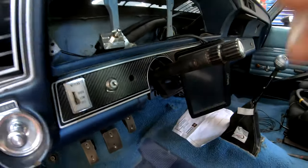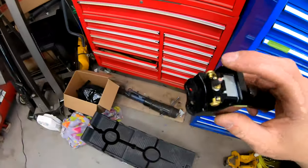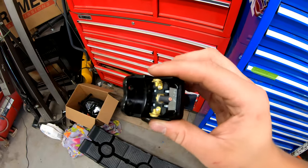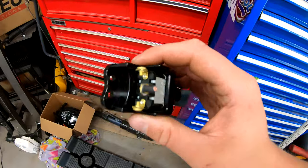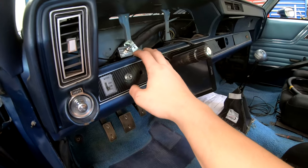I had to change my plan for the turn signal switch. This is an American AutoWire universal turn signal switch that I had to drill the dash to mount. Sadly, I won't be able to use the Motion Race Works billet piece — really my own fault for not having a great understanding of the turn signal system. The issue is it's a three-post turn signal switch, designed for cars with entirely separate turn signal circuits from their brake lights — power in from the flasher, then outputs left and right to the front and rear lights. Since this car has integrated turn signals and brake lights, I was getting weird behaviors: hitting the brakes would back-feed power into the flasher so lights wouldn't flash. This switch has separate power inputs for the brake light switch and the flasher, so they're separate circuits and everything functions as it should.